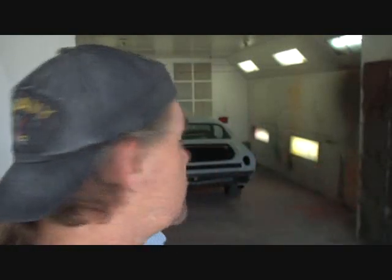So I'm really starting to get excited about our muscle car makeover because we are on the downhill slide now. That means we've already gone to the peak and we're climbing down that hill. We've already done all the extreme work necessary to it and have gone through the magnitude of dismantling the car, prepping the car, priming it, sanding it, priming it again, sanding it. Now it's in the paint booth. We've got to spot prime it only, lightly sand all that down, and prep it up one more time for paint, and I think it's ready to shoot paint on it. Let me get it taped off. I'm going to spot prime it up. We'll be back after I block it down and get it all prepped up, the final prep I might say.